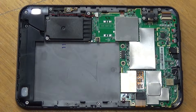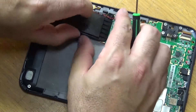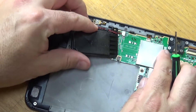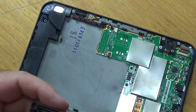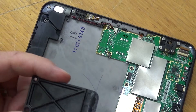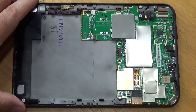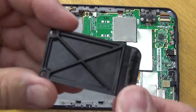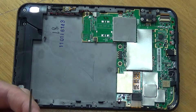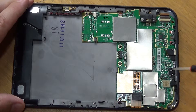We'll continue to pull down this Kindle. I'll start with this module here — it's fairly firmly affixed to the motherboard but I can remove it. Looks like just a spacer, or potentially another module that could have been installed in the device, maybe some more communications. This version from memory doesn't have any 3G support, just pure WiFi, so it's possible something else went in where this module would go. But it was just stuck down — there's definitely nothing else to it, it's just plastic. I'm also guessing the keyboard on the back will just be mini domes baked onto the board — nothing reusable.